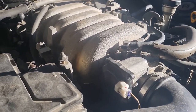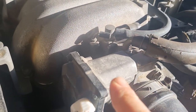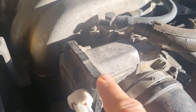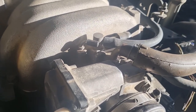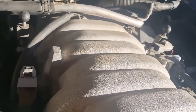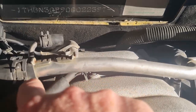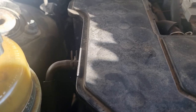You'll see that the photo has an extra hose in it, and looking at it, I'm thinking he's got a different throttle body. It's a little hard to tell, but I think he's got the six-speed throttle body - I did look at it on my phone so the photo was a bit small. We also have this hose here - see that one up in there? And it comes down here. And there's this hose here heading down there. I've got one other video about that. Those are for the idle up for the power steering.